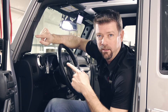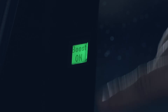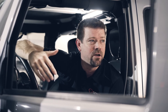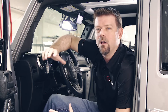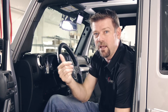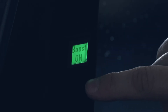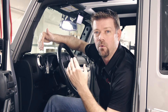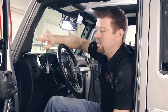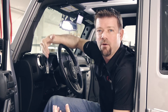Here's one more cool thing about the boost screen. I like to leave my G-Screen right where it says boost on or boost off. Think about a camping scenario: you're at the campground, lights on, listening to the radio, maybe talking on the CB, fridge running in the back. You want to come by and just check the status of the batteries. If you poke your head in the window and tap the screen, and it's green and says boost on, you know right away they're still above that 12.7 volt threshold — the batteries are still fully charged and linked together, you're drawing power from both to run everything. Everything's still good. If the screen says boost off and it's yellow, you know your cranking battery is being protected from being drained by your aftermarket accessories.